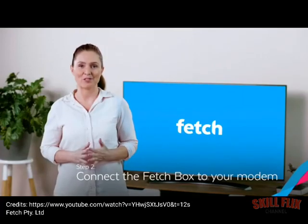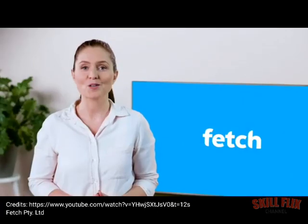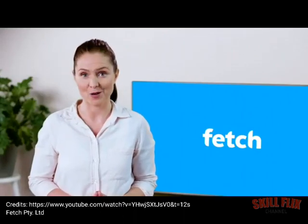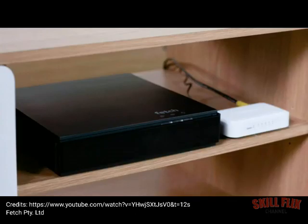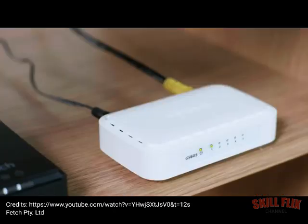Now we move to step 2, where we'll connect the Fetch box to your modem. Your box is Wi-Fi enabled, so it can connect to the modem via your wireless network. However, if your TV is close enough to your modem, we recommend using the Ethernet cable to plug your Fetch box directly into your modem. Make sure your modem is turned on and you have internet connectivity.